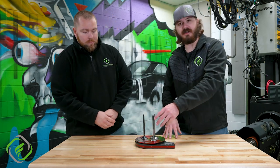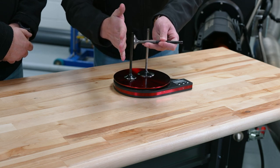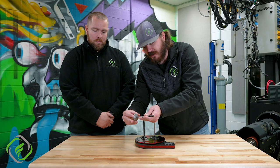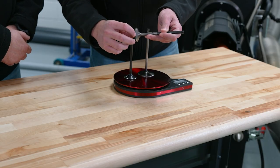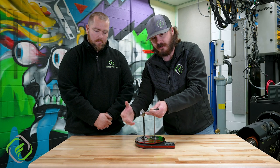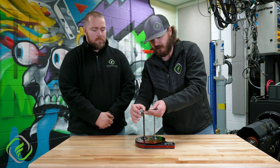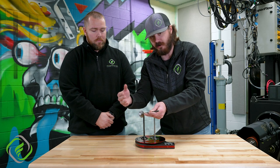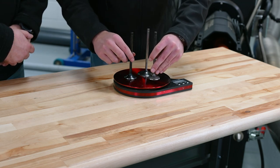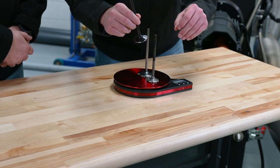Going into next, we're looking at the margin on the valve — that's this area right here from the face up into what we call the seat angle. The seat angle is also very important; it's actually what seals the valve to the valve seat. That is very crucial and there's a lot we can play with in a more in-depth video. The other one is going to be a back cut — you'll notice there's an additional back cut on this valve here.